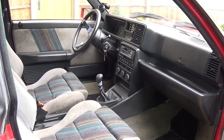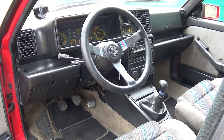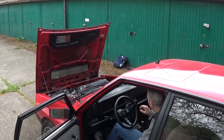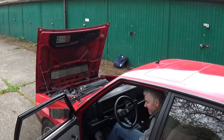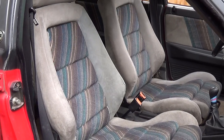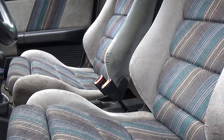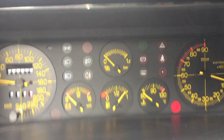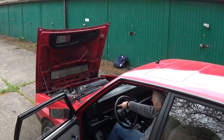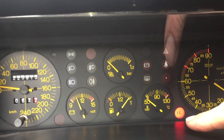Everything in here is quite fragile but it's actually improved a bit from when I first got it. There are a lot of rattles — I realised 90% of the noise was coming from a really badly fitted radio. The seats haven't worn too badly, but they are very prone to wear, especially on the bolsters and especially if they are Alcantara. On a 50–60,000 mile car if it hasn't been looked after you can expect these to be quite worn through. Make sure all the electrics work — on Italian cars you often get a plethora of warning lights. In particular watch out for the engine check light — the red IE light should go on when you switch on the car but should then go off. If it stays on, there's something wrong.